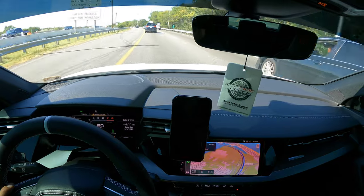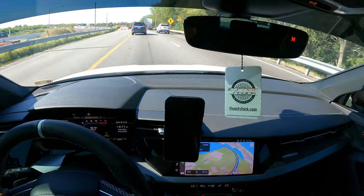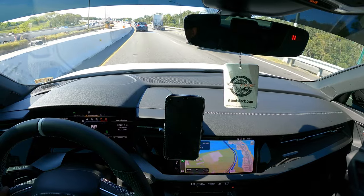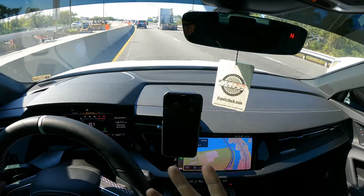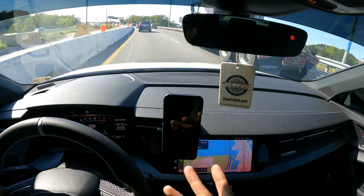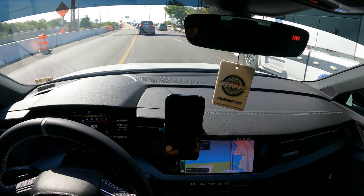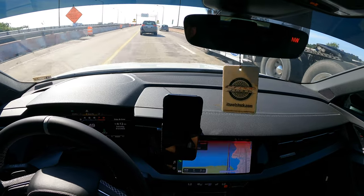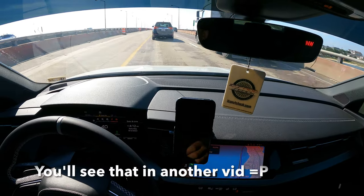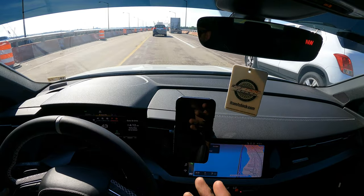I just had a thought — I can feel that when the Racing Line box is plugged in, it doesn't shift as quickly, and after the shift it takes a bit of time to get back on the power. It's like it's dropping all boost — or at least half the boost — between shifts. It's just a piggyback, just tricking the system, so something's going on with the trans. Maybe if I unplug it and try again with ethanol that might be the move. If I'm feeling froggy tonight we'll go back out and do another couple passes. Thanks for watching.